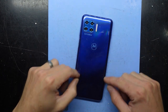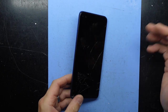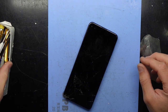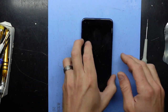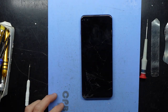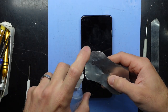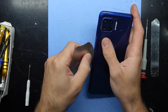Once we get in there we're going to use isopropyl to take the battery out, disconnect the screen, and from there we should be able to take the screen out and continue. What I'm expecting we're going to need is a thin pry tool, a very small triple zero Phillips head screwdriver, and potentially another little pry tool. To begin, I'm going to spray isopropyl on my very thin pry tool and work my way into the back of the phone.